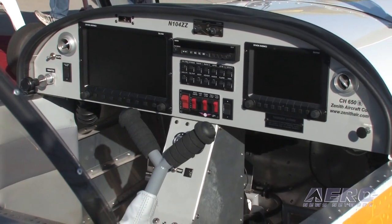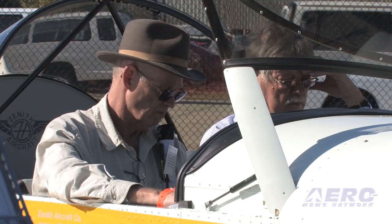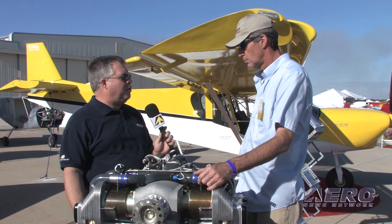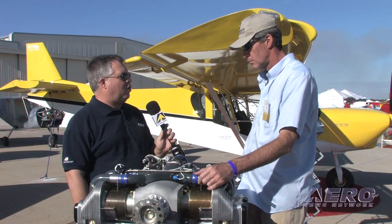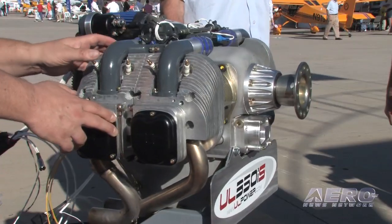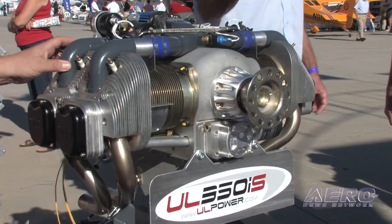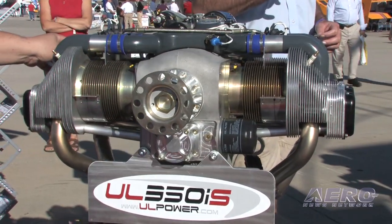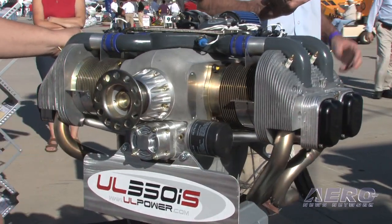Basically decreasing cockpit workload — substantially. When you're talking about flying an LSA and the pilots who might get into one, does that really help lower the barrier to people who want to begin learning to fly? Yes, I think so. If you ask a pilot today to think back on their flight training, it was different from plane to plane. Some planes had carburetor heat playing an important role, and they had to remember to use it at certain times. With this engine you don't have that. Mixture, same way — a lot of people when learning to fly were afraid to lean the engine, either keeping it too rich and fouling the plugs, or leaning it too much and killing the engine. This takes away some of that fear and makes it easier.